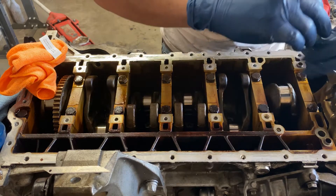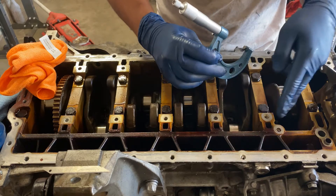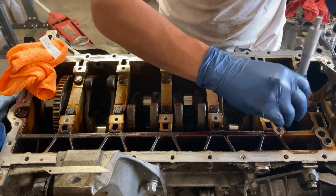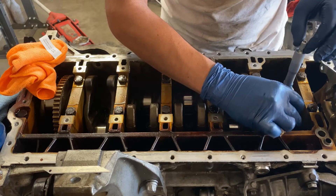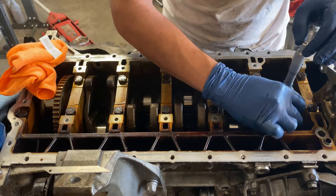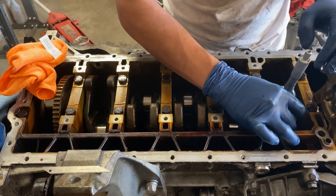When you're checking your rod journals, you want to check them horizontally and vertically — checking from 12 to 6 o'clock and from 3 to 9 — to compare the wear when the piston is moving up, and also laterally, to make sure they're not egg-shaped. I'm going to put it in here and use the small knob on top of the micrometer to slowly go down until I start feeling some resistance. Make sure there's no side-to-side play, and it should have just a tiny bit of resistance — you don't want to scratch it.